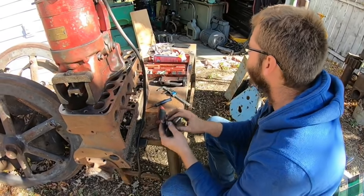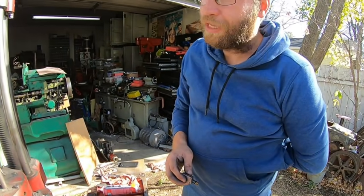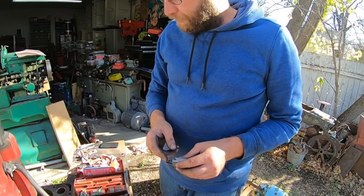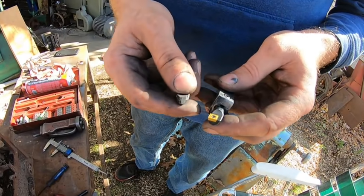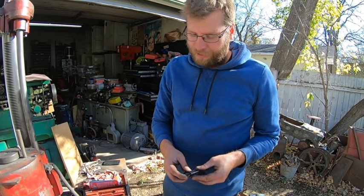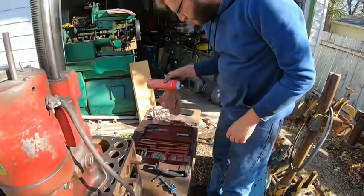The issue is I only had two short cutters here in this kit, and you can see the issue is where I got to grab it there'd be nothing left. So we're going to try a more modern carbide — this is a little CCMT 21.51, it's got the little radius on it. How well it works — it might work good, it might vibrate the whole thing down, we're going to find out. If it works good I'll probably end up buying a few more of these just for different lengths. The only thing is this is a different geometry than the regular cutters — this one's a straight down, this one comes in more of a threading tool. But we'll see how it cuts. On a scale of one to ten I'd give it about a six — it is a fair negative rake — so we'll see: go or blow, that's about it.